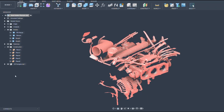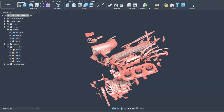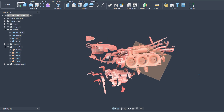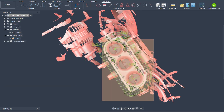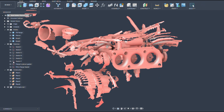After I got a good scan, I imported the mesh into Autodesk Fusion. Normally I would align the mesh to the coordinate system before modeling, but since this is a relatively simple part, I'm going straight into modeling. I start off by making a three-point plane on the face of the throttle body, which I then use to start my 2D drawing. Then I trace out the mounting holes and other features from the throttle body and build out from there.